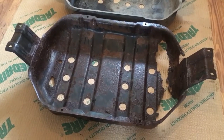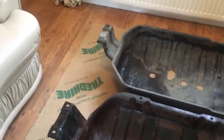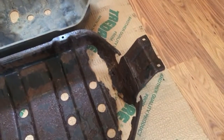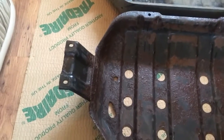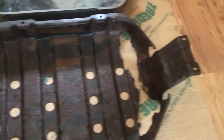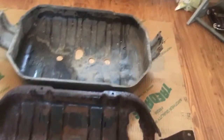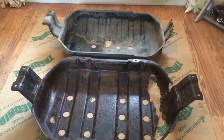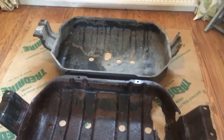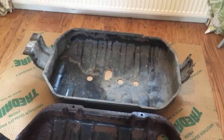This is where a modification comes in. You'll see that end bracket there is very, very similar to that bracket, but the one at that side is very, very different. So the modification you have to do is cut off one of these old brackets off your Frontera tank, cut off that bracket off the Trooper tank, and obviously do a little bit of welding. Talking to people on the Frontera group on Facebook, that is your best bet. And once you've done it, the Trooper tank guard pretty much lasts forever.